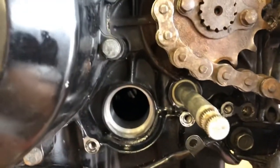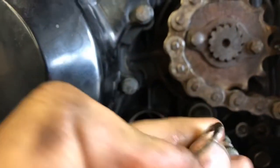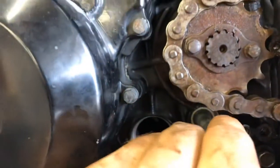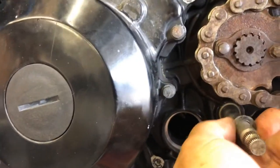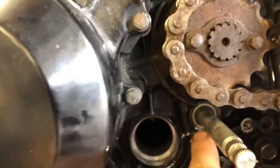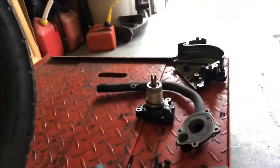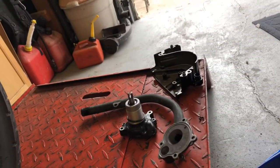That's why I went to all the trouble to find a washer with the same outside diameter — I drilled out the center and filed it, even if I didn't do an amazing job. The important part is that outside diameter. So we have that seal driven in there, and now we just need to start putting stuff back together. I've cleaned all the parts — the two halves of the water pump and the cover — and we need to reassemble.